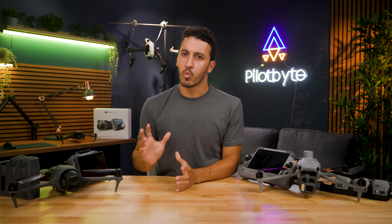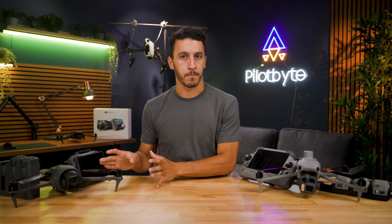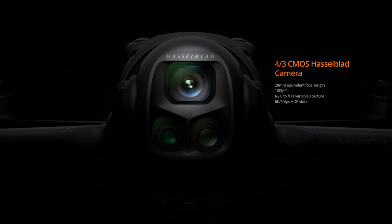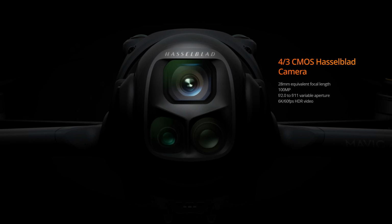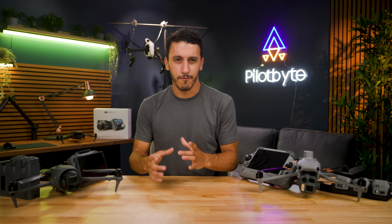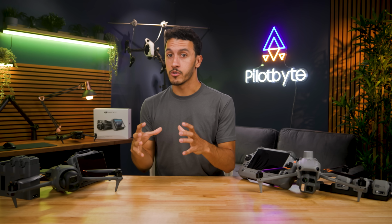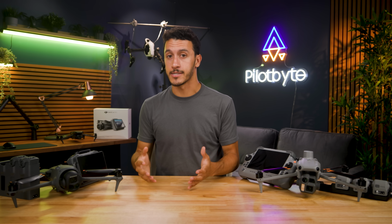Now, let me explain one thing before we move on about these resolutions on these cameras here, specifically on the 100 megapixel mode. When you activate the super resolution mode, the camera rapidly captures multiple 25 megapixel images, each slightly offset using tiny sensor level shifts or the natural micro vibrations, and then uses onboard processing to stitch them together into a single high resolution composite.